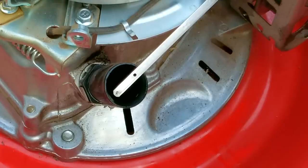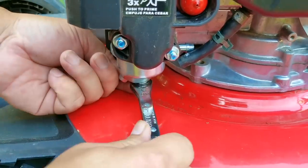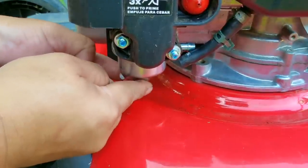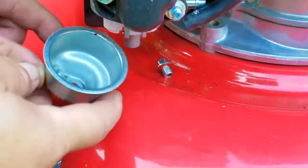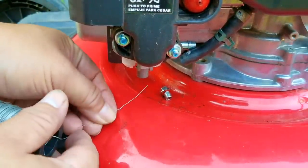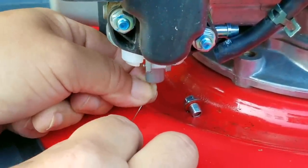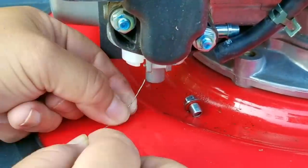The last thing I want to do is clear the fuel jet inside the carb. I don't think we'll need to remove the carb based on how the engine was running during the test start. I'm going to remove the bowl, and if it looks decent I'll clear the jet while the carb is still on the engine. If the bowl looks terrible, it's recommended to take the carb off for a full cleaning. There's a small amount of debris in the bottom of the bowl, but it's not that bad. I'm running this wire through the jet to clear the opening — making sure I can push at least an inch or more of the wire into the pickup tube. If you're hitting something about half an inch up it means you're hitting the side of the jet — try to push the wire in the middle of the tube.